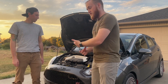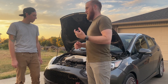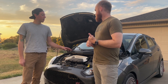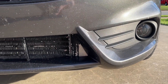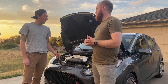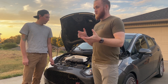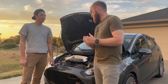And that's it — a stock-looking but not stock-feeling Fiesta ST. Jared, while we're under the hood, tell me a little bit about the mods you need to do if you want to upgrade to an S280 or just an upgraded turbo in general. It's actually really simple to get these cars ready for a big turbo. I'm on the stock intake, just a little panel filter drop-in. Just an intercooler upgrade and a downpipe upgrade with piping to go with the intercooler, and some silicone — more preventative than anything. That's all you need for the car to be ready for a big turbo. I don't think people realize how over-engineered these cars are — they can handle a lot of horsepower just with supporting mods.